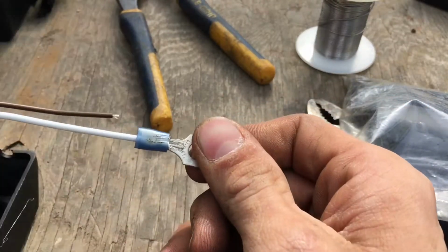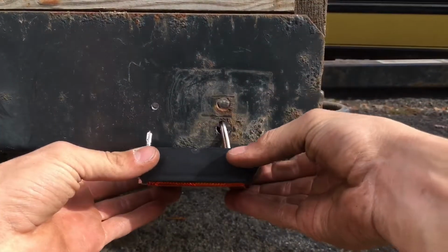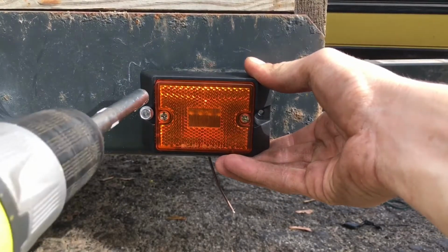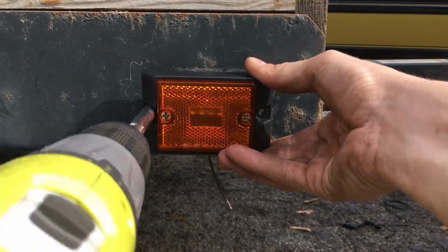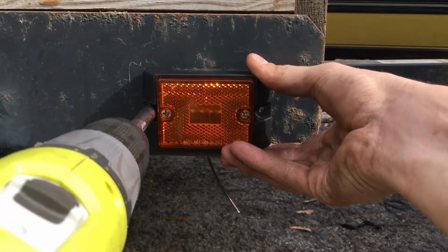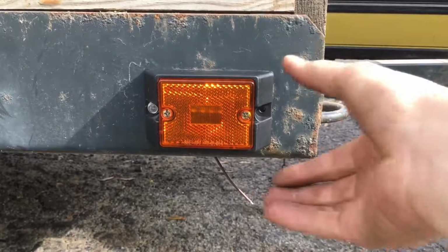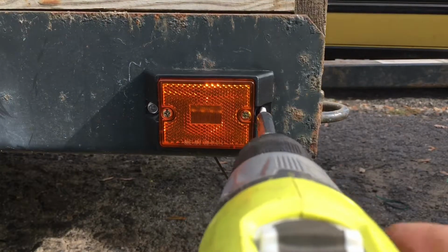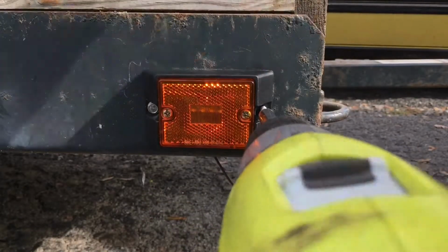Alright, I'm probably going to wrap these ends with electrical tape. Now we're going to fasten our light here. I got both wires stuck in there, the white and the brown. I'm just going to use self-tapping screws here. This one I already pre-drilled so it'll go in easy. Just like that. We're going to put in our other screw. Even the marker lights are all LED. I got them on Amazon for $20. I'll leave the link in the description if anybody's interested.